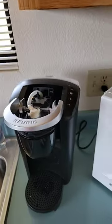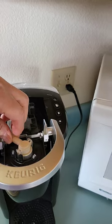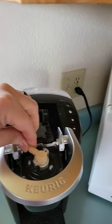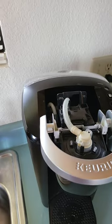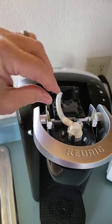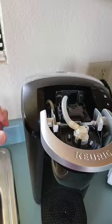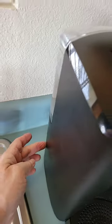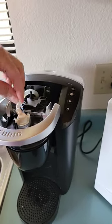Pull this off by pushing the two tabs up — I've already done it for quickness. Remove this tube from the top of the coffee pod. What you want to do is prime that water tube — continuously pour water into that tube. I just made a little funnel with my hand. Continuously pour water; you'll hear it falling down into the reservoir once that's full.